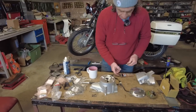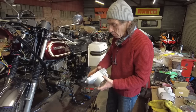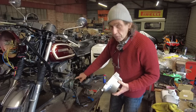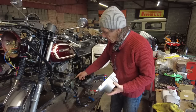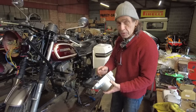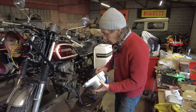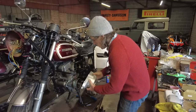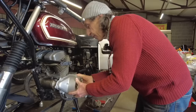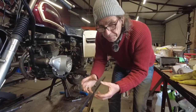I'm about to put the cover on - one word of caution: there are two dowels which locate in this outer case, acting as guides to hold it in exactly the right place. There's one at the back here and one down here. Make sure those are in the crankcase or in this cover - it doesn't matter which - but you do need them, because this has to be located exactly as the points are held on this plate. If this is on slightly wonky you'll have all sorts of timing issues. Make sure you haven't lost the dowels when you've taken the case off. I've already put a new gasket on. Just make sure it locates nicely on the dowels - the magnet pulls it - you just jiggle it and there you go.